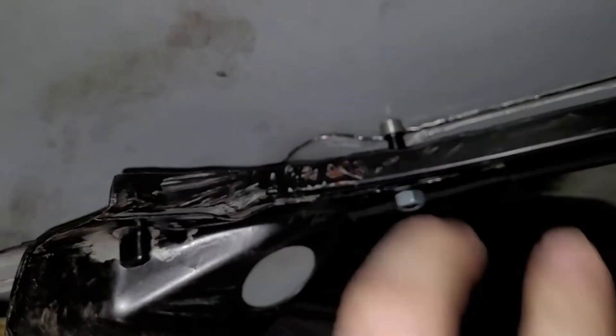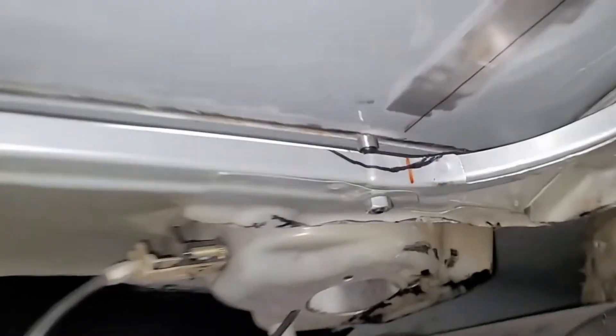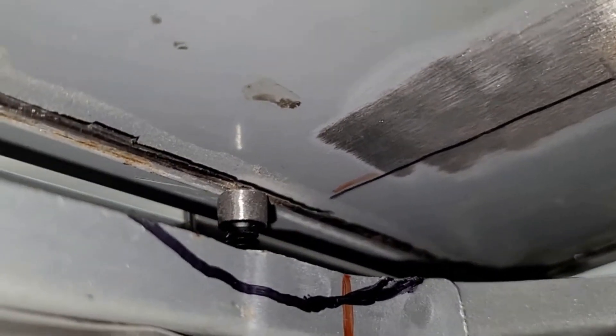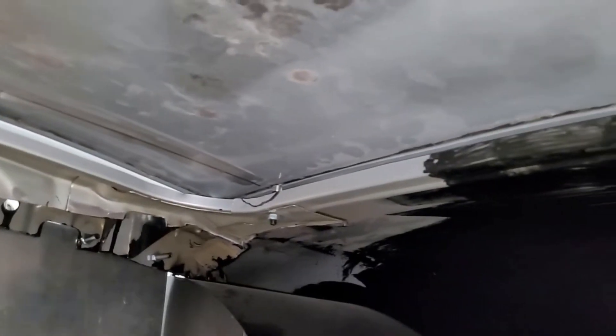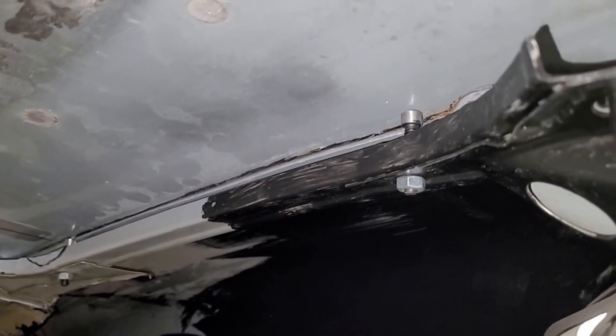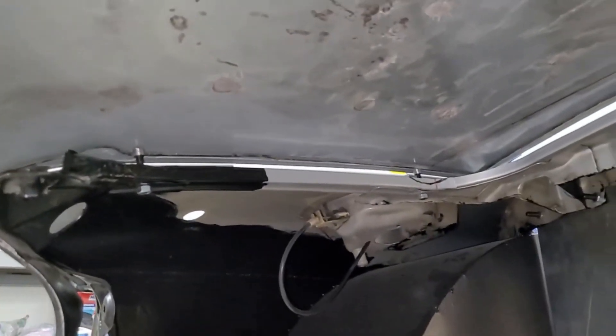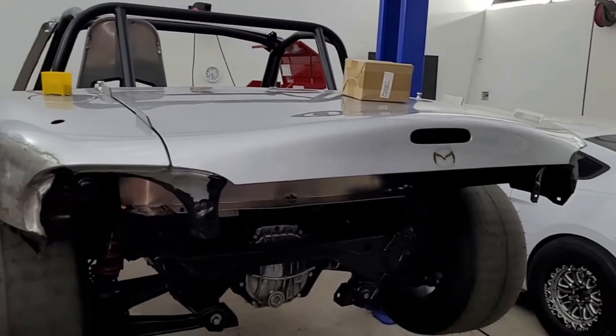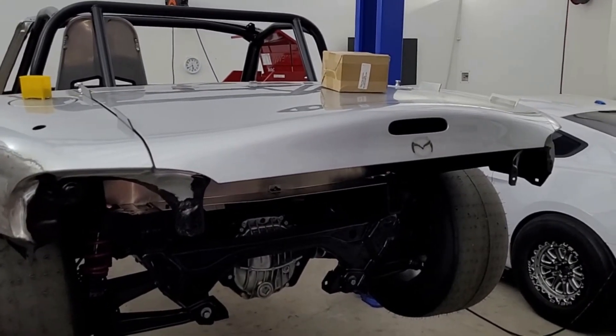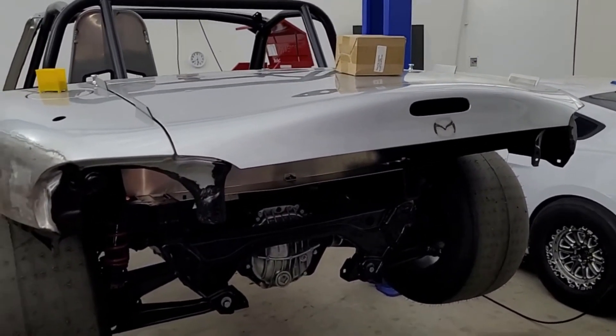I'm afraid to glue it - I don't know if it would hold long term - so I'm probably gonna try to weld it and hope I don't mess the deck lid up too much. I just need to tack a piece of plate to the factory sheet metal in all four spots. These are right on the edge of a piece of sheet metal, which is a little tricky, but the point is we'll mark those and put sheet metal there so the bolt heads hit that plate. If I can do that and hopefully not warp the panel too bad, then when I weld the bolts to that other plate it shouldn't warp the panel any further. We probably need to add a bolt or two in the middle as well.